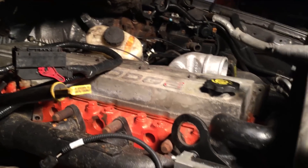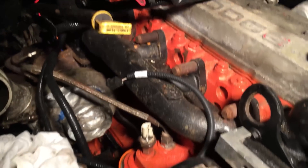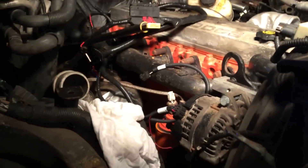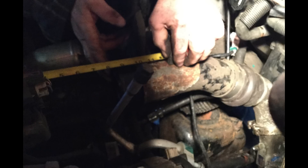The next thing I made up was the turbo intercooler piping. I just took it off to flush it. For the intercooler I used simple exhaust pipe — I used the Dodge turbo pipes and turbo boots, cut them off and made them fit the Ford intercooler. It worked pretty good.